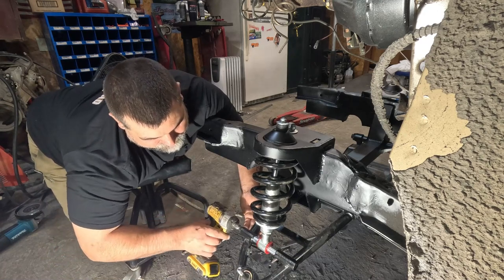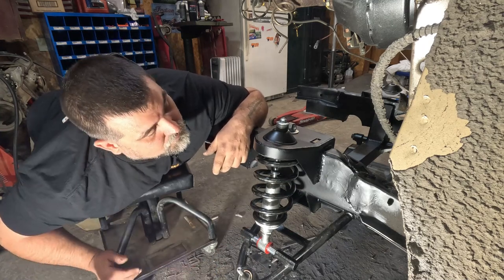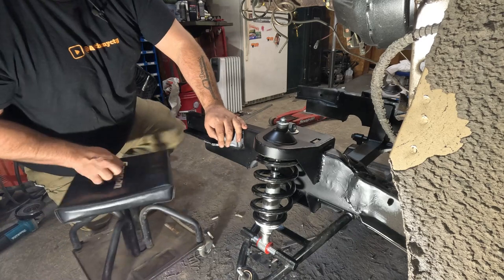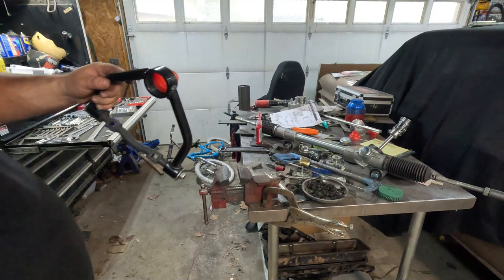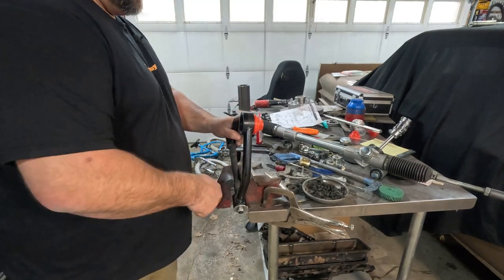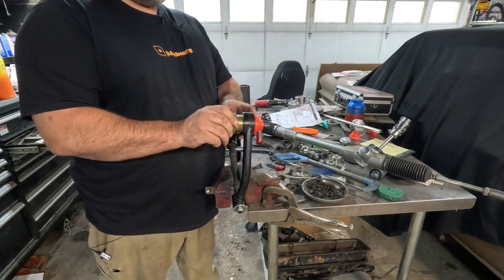Run around there a little bit — I mean all the way. I believe I need to bring the jack over here and push this up so we can actually get the top in. Let's go ahead and get our upper control arm on. Got my boot installed and of course a bunch of Loctite. All these ball joints you've got to thread them in — China, high quality. Take your high dollar ball joint that's probably going to fail after a thousand miles and screw it in.